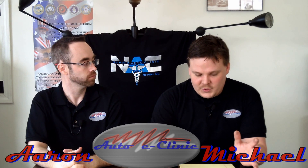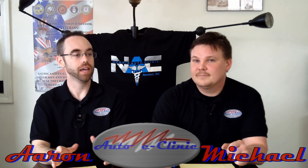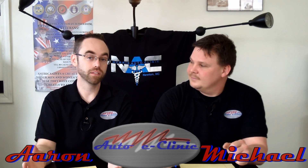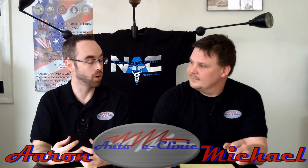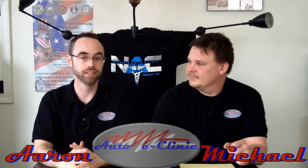As far as the quality of the filter — dealer or aftermarket — as long as it's good quality, it doesn't have to be a dealer item and doesn't have to be aftermarket specifically. You can go with either one. The biggest thing you don't want to do is use a cheap filter, because sometimes those filters will come apart inside, clog up the system, and burn up your fuel pump, costing you a lot of money.